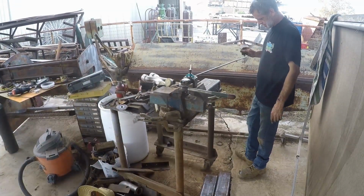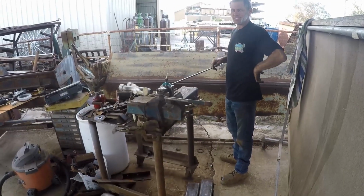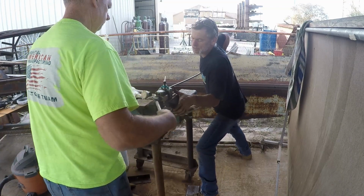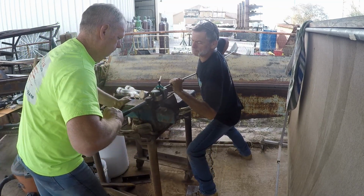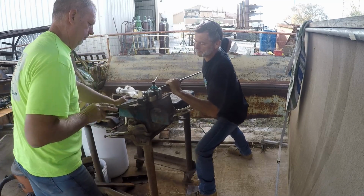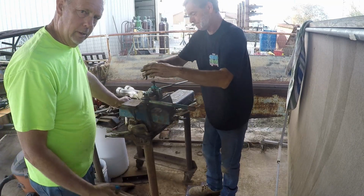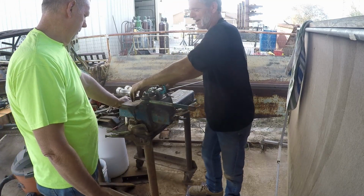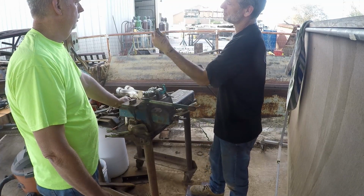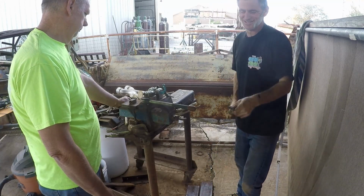We're gonna make a fuel line. I was corrected by Mr. Thomas. We'll make one right now. All right, you want me to do this? Yeah. Oh, man, I keep pushing through. Let's see what we got. Our dies are getting worn out, so yeah, not quite. I've been brutal to this tool. Well, actually, yeah, that'll work for fuel. Won't work for brake, but it'll work for fuel.